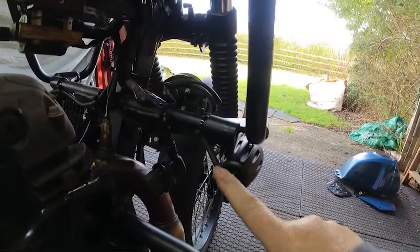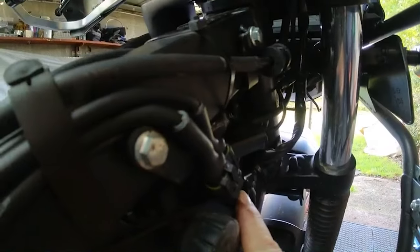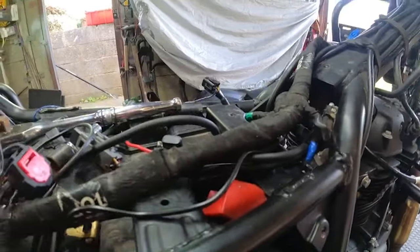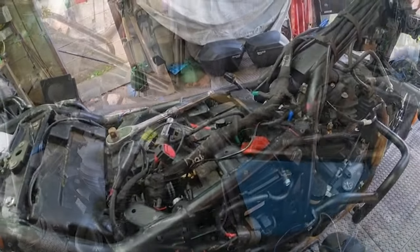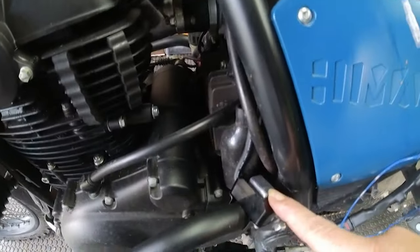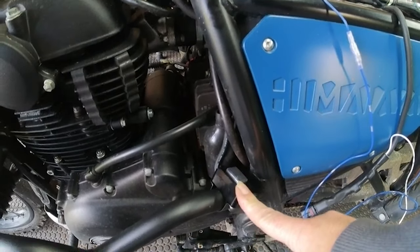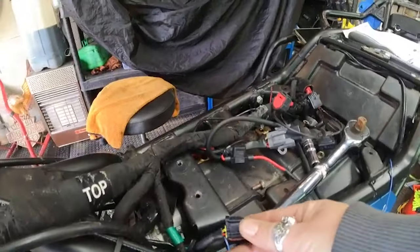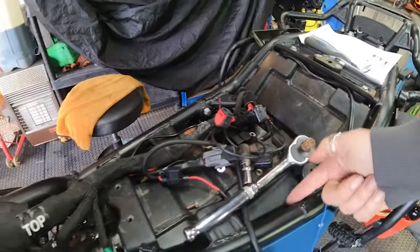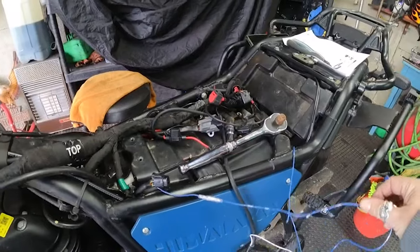Here is the back of the light — I've routed the wire at the back of that rail, it comes up here and the two plug connectors are there. Then I've routed it down the frame, under the frame, and up into this wiry pickle in front of you. Because the wire into the switch is excessively short, I've mounted the switch here on the clutch side so I can just reach down and flick it on. I've routed that up at the back of the frame — the plug comes out here, which enables me to route the wire around the back of the tray, up under these two stays, and cable tie it down into that groove.